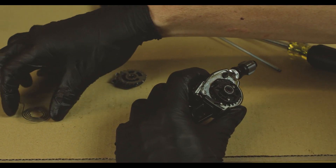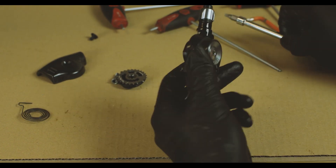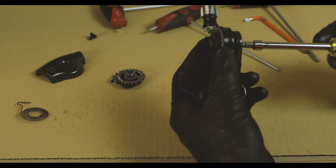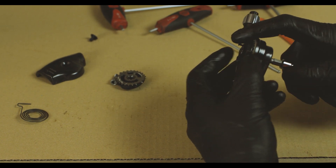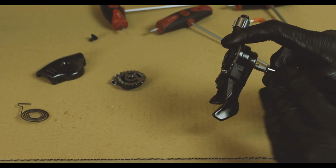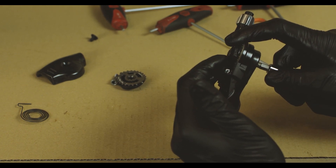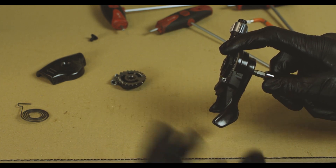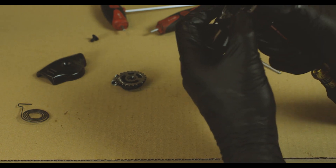Pull this spring right now and set that aside — make sure you keep it clean. Now take the square bit and insert it onto the bottom of the shifter. We're really just trying to keep the square bolt steady while we unthread the 4mm pivot bolt out of the top. Apply pressure from the bottom so that we're just getting the 4mm pivot bolt to back out, rather than both things backing out at once and loosening the whole shifter. This is a little bit tricky, but if you go slow you'll get it no problem.